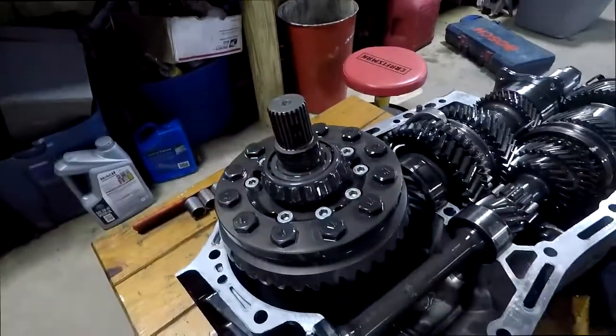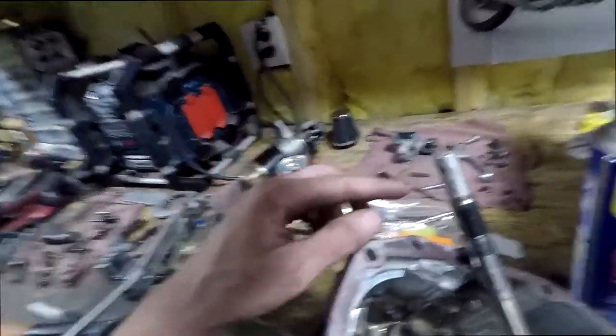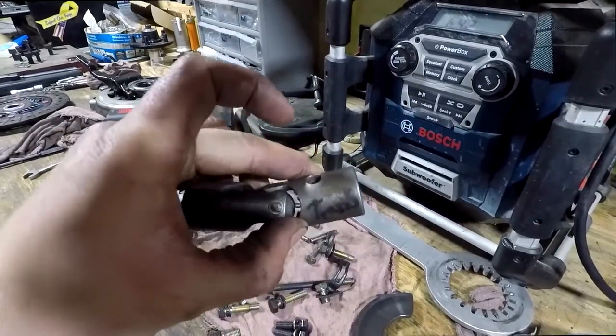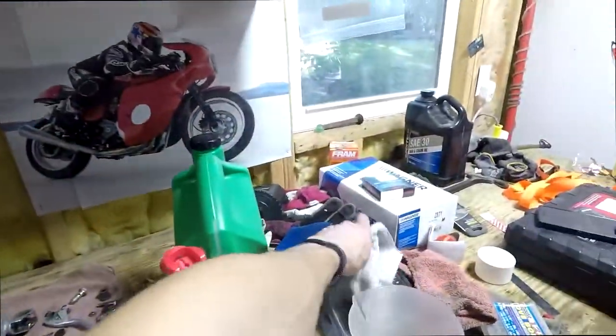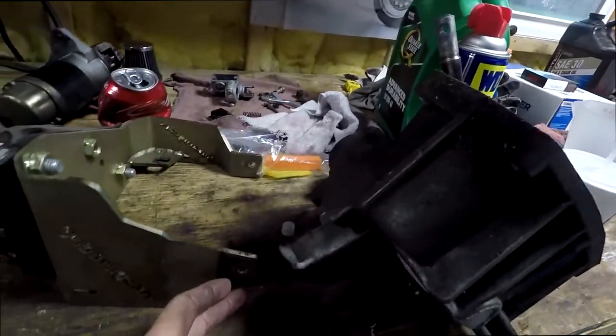You cannot go beat on any shaft with a bearing on it because I think it's called Brinelling - you fracture just tiny tiny bits. You don't want that on your differential main bearing or your transmission. Also, on this gear selector shaft there is a pin in there and it goes through this little CV joint right there, and I see people beating on those things.